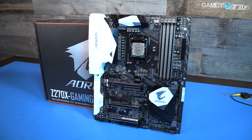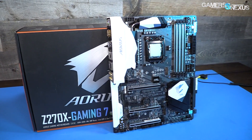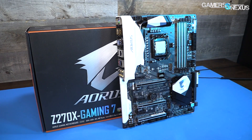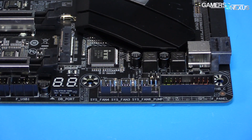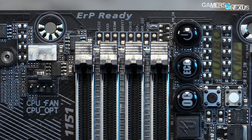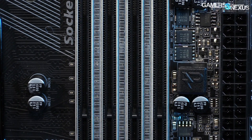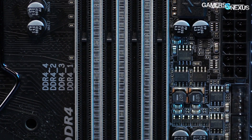The board makes abundant use of full PWM 4-pin headers, and there's support for up to 2 amps throughput on the hybrid fan headers with OCP available. There are additional pinouts designated as pump headers, useful for isolating cooling solutions by label. Gigabyte also provided a pre-production BIOS fix that resolves some memory overclocking — achieving 3200MHz XMP is not a problem with the Z270 board.